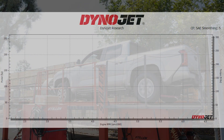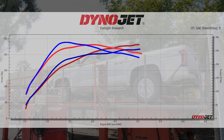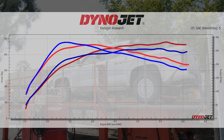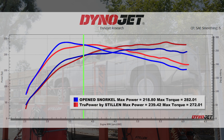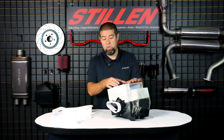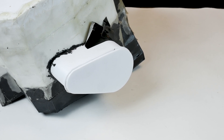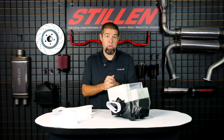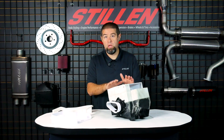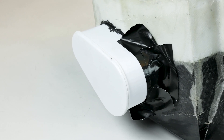With the snorkel port opened, we did see a slight bump in initial horsepower and torque, but it then declined to be about the same as factory at peak RPM. After 3,800 RPM, the power starts to decrease and peak horsepower drops back down to factory output. So we're going to recommend shipping this air box with the port sealed, and we do not recommend opening it unless you run a proper snorkel — whether the TRD snorkel or an aftermarket snorkel using that same TRD teardrop shape. That increased temperature is going to hurt your overall power and performance.